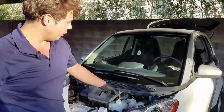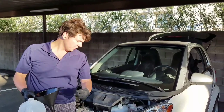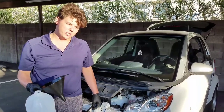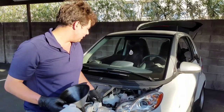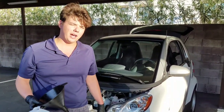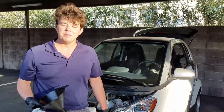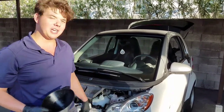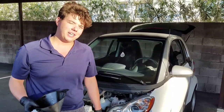There we go. We're going to go back and fill this reservoir up — we're going to do that three times to flush out the system. The full fill on this is about 4.1 quarts initial fill, and this reservoir is probably about two quarts, so the radiator probably only takes about two to two and a half quarts. If we flush this three times we should get basically all the fluid out. I do recommend you get that proper tool from a Mercedes mechanic. We really appreciate you guys tuning in — it's always better to change these fluids earlier than later.